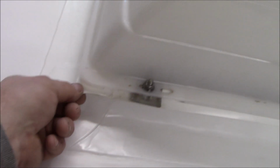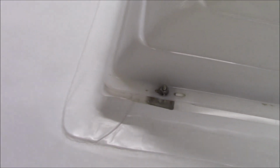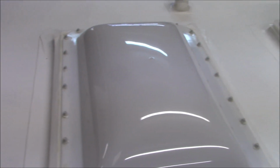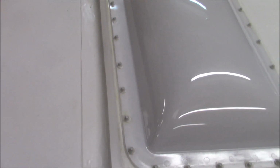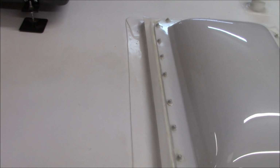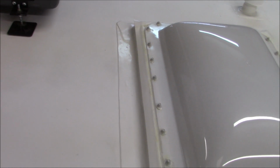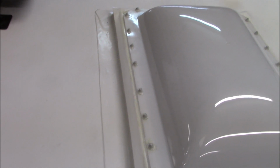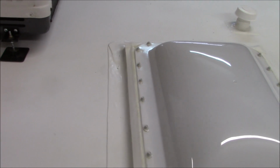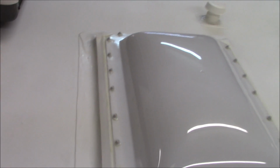We've got a counter flash on here. And what the purpose of that counter flash is, you get caught in a heavy rain. I'll back this up a little bit. A lot of the issues that you have with your conventional systems or even a flat roof is you have a lot of erosion effect where water is just constantly rolling over things, and that'll kind of compromise the seal that's on that particular detail flash, right? If you were to just put this down and they screw it down, you slobber it with caulk and you got water just rushing over it all the time, it is eventually going to wear it down.